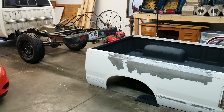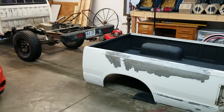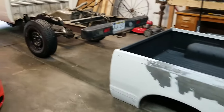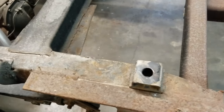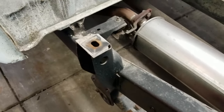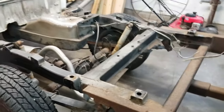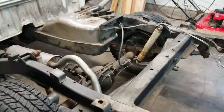This is a little bit awkward — I forgot to hit record when me and my buddy took the bed off. So the grand reveal wasn't really that grand; it's just off the truck now. But let's take a closer look at what happened. We have bolt spot number one right there, two right there, three right there, and then three on the other side — the exact same right across. So those are your six bolts that come off to relieve the bed from its mounting spots.